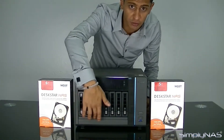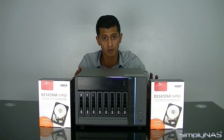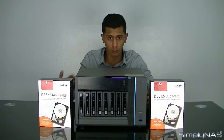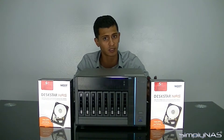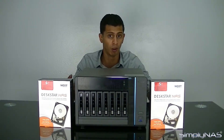Underneath every hard drive bay, you have your HDD status indicators. When your NAS is on, those will be green when your hard drives are absolutely fine. If something goes wrong, there are two colour LEDs: first is yellow, which lets you know your NAS is on its way out; the second is red, which always means stop — your NAS or hard drive is dead.